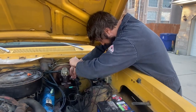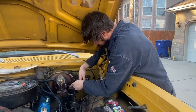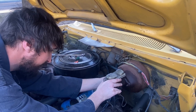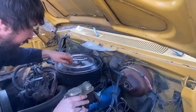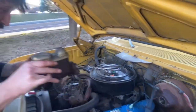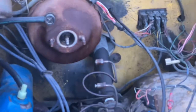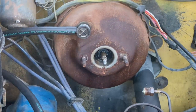Removal is pretty self-explanatory. You have to remove both of the brake lines going into your master cylinder, then remove the master cylinder itself from the brake booster — it is relatively heavy, so be careful when pulling it off. You can see the massive leak I had here. If you've never seen a brake booster before, here's a closeup — you've got a seal in there. You could adjust that rod, but I'm not going to touch it because everything is right where it needs to be.